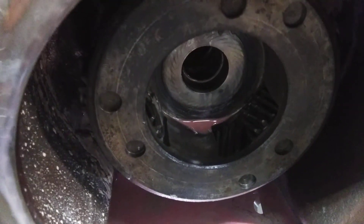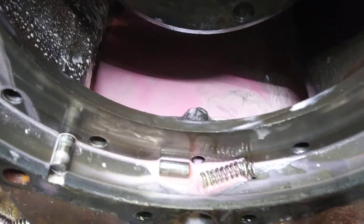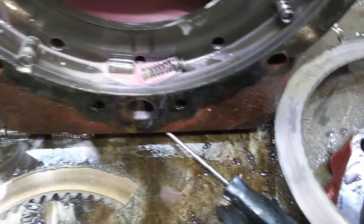And inside there — see that strawberry milkshake. It makes a nice thick goo in the bottom of the sump, makes the pump work harder and the transmission overheat.